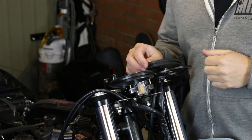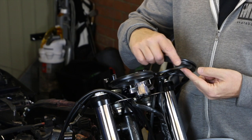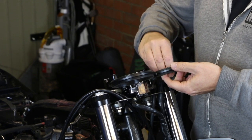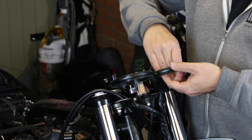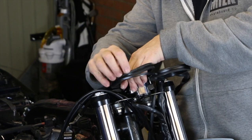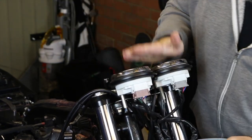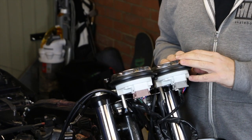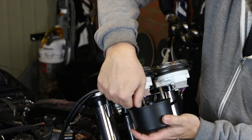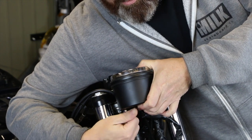The next job is nice and easy — putting the rubber seals back in. This is where you can see the notch that you've got in the top of the arm. There's a little section on the rubber which means that you can put those in exactly the right place. So just sit those two rubber seals in place, then feed the wire up in the slot on the back of the pod until the prongs push through, and then put the little dome cups back on.